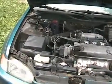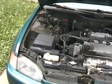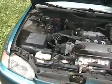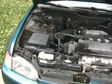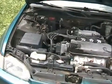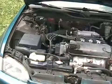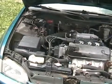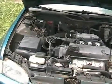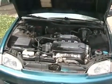And if you have a cone-shaped K&N air filter on the front, that's less restrictive than an airbox, and it allows engine sounds to emanate, and of course it increases flow too. So you won't really notice anything until your RPMs start to get maybe past 3,000, 3,500 RPMs, and then you'll notice the slightest increase in top-end performance and maybe the slightest increase in top-end fuel economy. Not a big deal, but kind of looks nice under a hood with a lot of black.